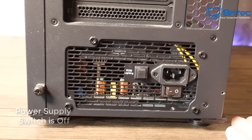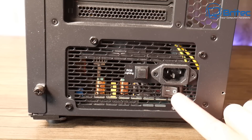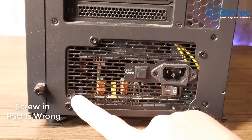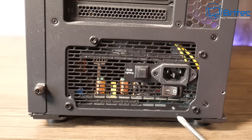Next up is the power supply switch being turned off. I've seen many people — and done it myself — forget to flip the PSU power switch on, and suddenly think the PC is dead. It doesn't take long to work out, but it happens. Another thing is putting screws in the wrong place on the PSU. You can see there are designated screw areas, but there are a couple of wrong holes where people put screws — it won't damage the PSU much, but people will notice.